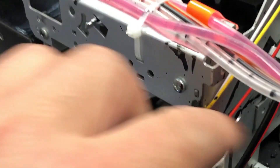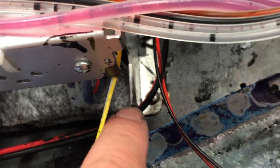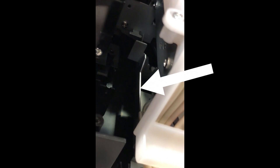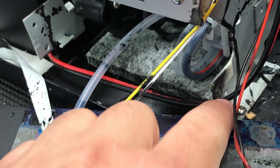There are seven screws that stabilize this cap station on the printer. However, this printer has the front bar removed, so it's missing two screws for the front bar. Otherwise, there's a first screw here and a second screw here. I have an unmodified 1800, so I'll just open the gap and peek in — here's the front bar. If you have that bar, you're going to have the first screw here and the second screw here.